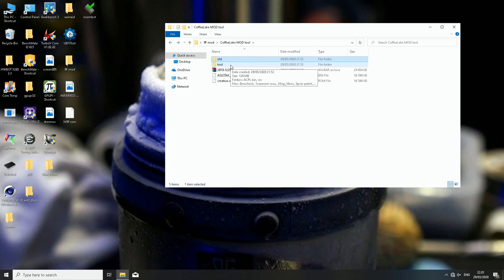But if you want to use an R0 stepping 9900K or 9700K, you have to figure this out before you do this. You can see it from the top part of the CPU IHS, but pretty much, if it's an R0 stepping CPU, it has to be dated 2019 or newer. All 2018 batched ninth generation CPUs are P0 stepping. So just be sure that you know what your CPU is before you do this, because the whole process is very, very picky.